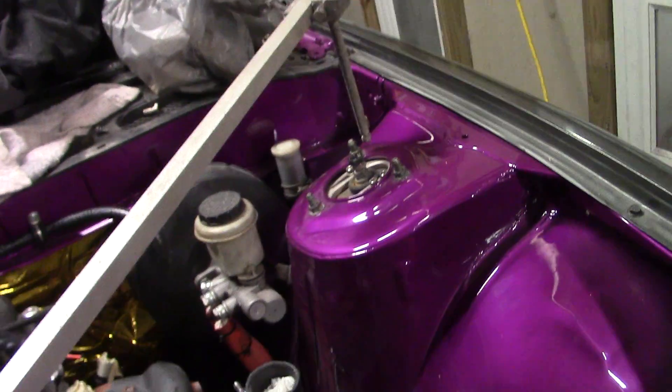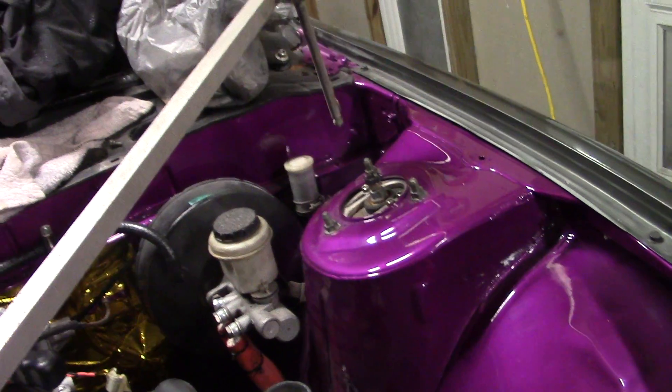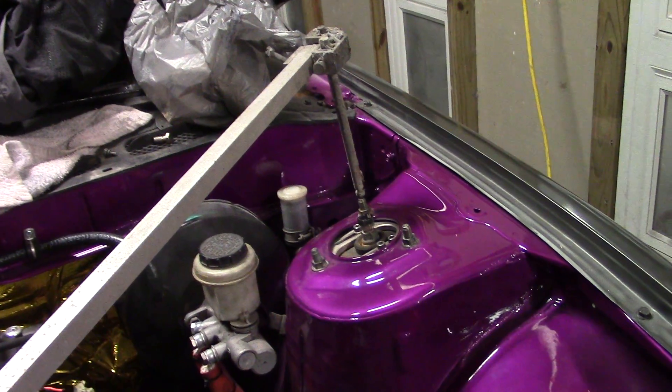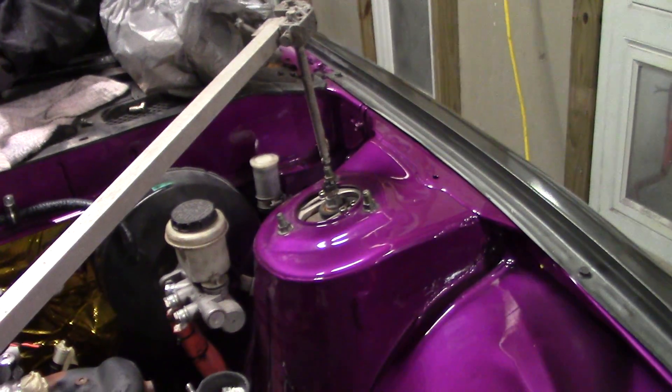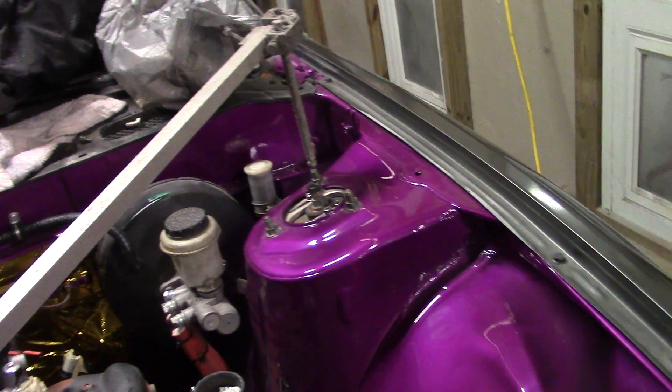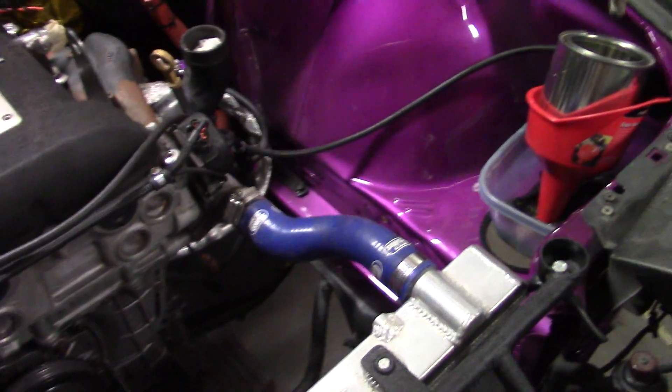What we're going to do is put this pin on this bolt and drop this pin on that bolt. You can see we're on that bolt, we're on that bolt, and we're square. So now we're going to take the same measurement on the other side of the car and we should get a perfect X here if the car has never been introduced to the guardrail or the wall.